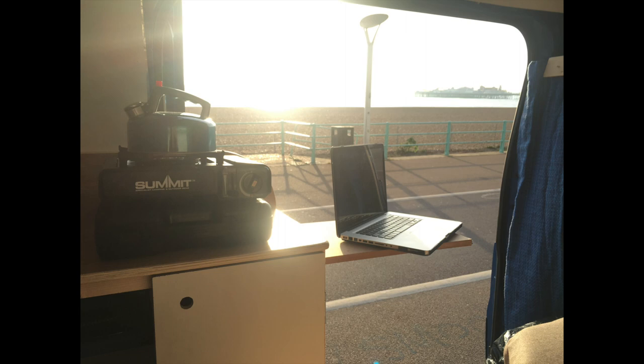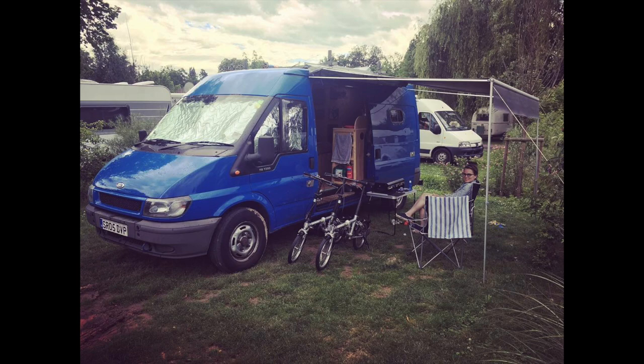Also, when we're leaving the van — as we did on our road trip around Europe — it was nice to be able to lock the inside of the back of the van, knowing it was difficult to break into when we were in places we didn't know. When you double lock a transit van — so when the hazard lights flash on the outside — that actually double locks the front doors, but it doesn't double lock the back doors. So if somebody smashed the window and didn't get through the central locking, they still wouldn't be able to open the front doors from the inside.